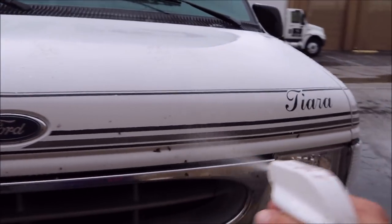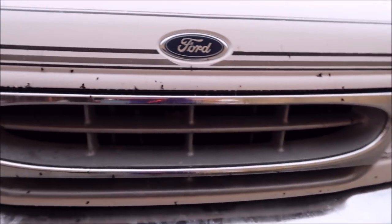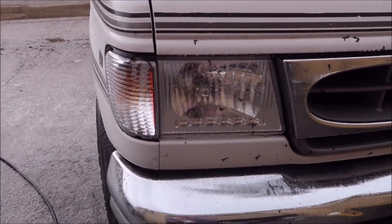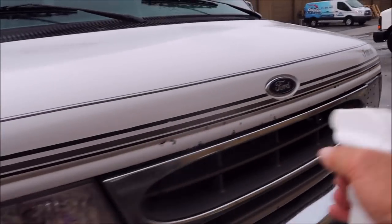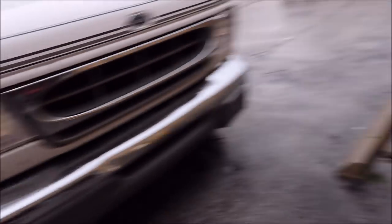Because I'm not going to allow that to happen to my vehicle, I'm going to take the Infinite Purpose Cleaner and just spray it all over the front end, give it a second to dwell. The Infinite Purpose Cleaner will strip any wax or sealant on your car, but if you've got one of the higher-end coatings it's not going to hurt anything. You can see all the bugs on the mirror — spray it all down. I'm not going to worry about the windshield because it's not going to etch the glass.